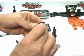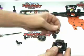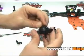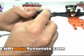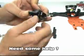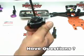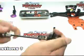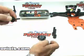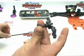We're going to take our Team Fast Eddie Pro Series bearings and use our thumb to press them in — that one actually snapped right in, went in beautifully. We're going to go from the other side — that one is a little bit harder to get in. Just to make sure they're fully seated, we're going to go ahead and use our bearing press and make sure they get all the way in. We're going to go ahead and remove it, reassemble the bearing press once we've taken it off so we don't lose any parts, and file it back into our tools bag so we can use it later on when we need it.